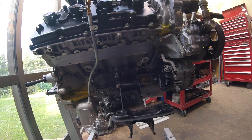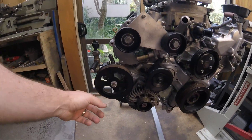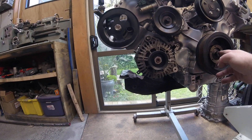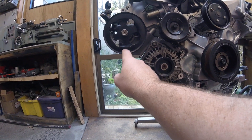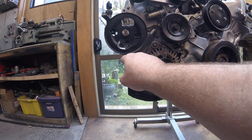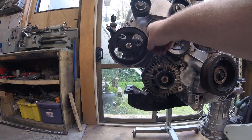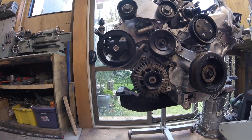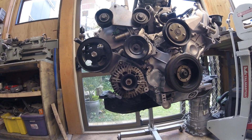The power steering pump is a long way out from the centerline. We've got 700 millimeters between chassis rails, about 350 to the center, and the pump actually goes over the top of the chassis rail. I think we need to run a custom pulley to get our clearance — a slightly smaller pulley, which unfortunately will make it spin faster. But that's not a big deal since this engine isn't going to be pulling big revs all the time; it's going to be a road car.